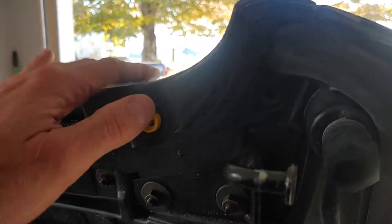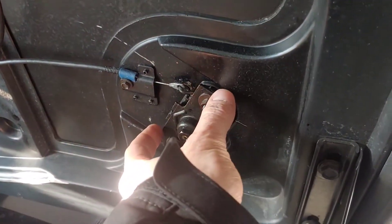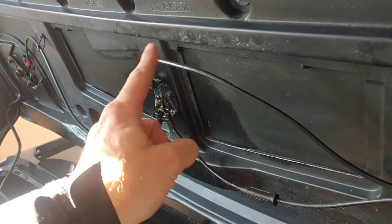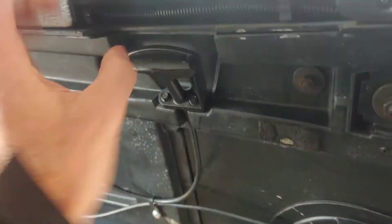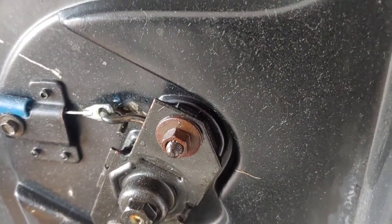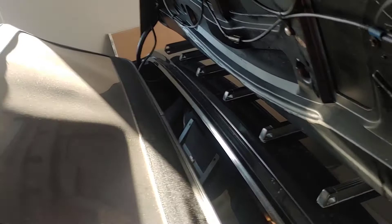And that lifts up this lid. So now that this lid is lifted — I'll just drop the roof back down to show you — this is the button, this is how we release the trunk. This is electric. This is the mechanism that was missing off my car. This mechanism was in place on both sides. What was missing on mine is this whole cable arrangement. This is what pulls, and this is how we release these pins. These pins get latched into these holes, and that's the handle we use to release this.